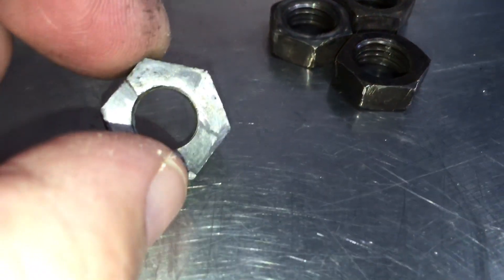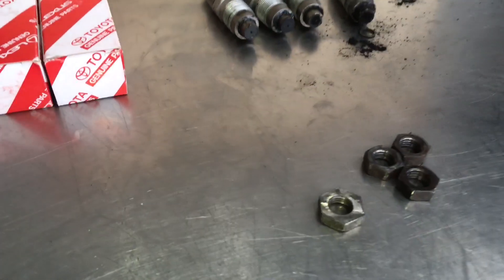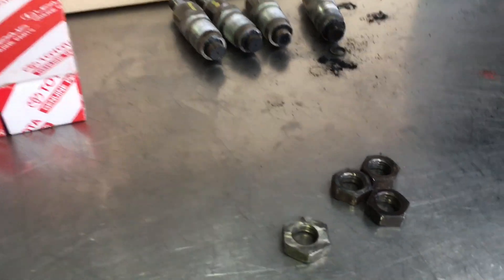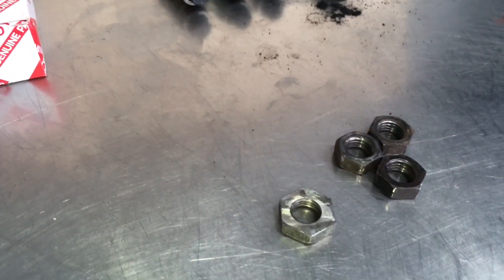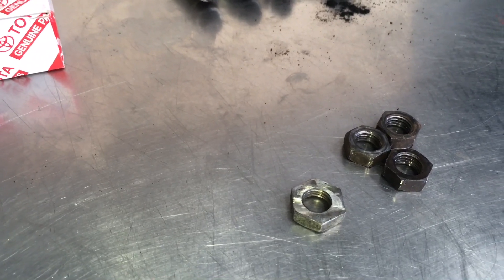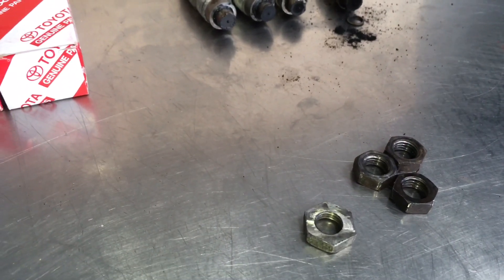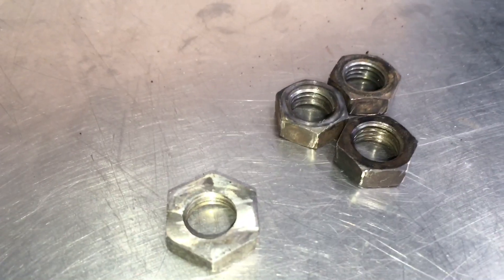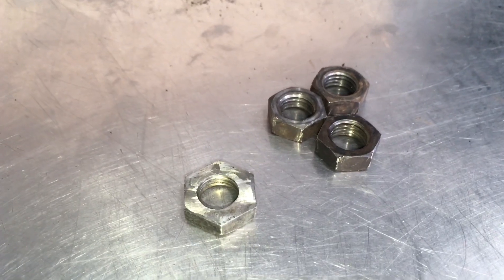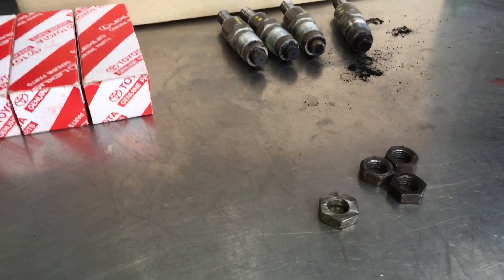The good news is all this is going to get fixed up nicely. Brand new clean injectors, there'll be four injector seats torqued to specification - 54 Newton meters. The fuel return line will be refitted - I think that's 30 Newton meters. The fuel lines go on at 15 Newton meters. So: injectors at 54, those nuts at 30, and the fuel line at 15 - but check that because I could be wrong.